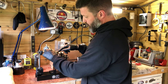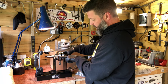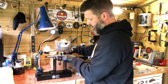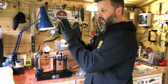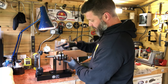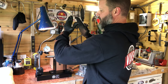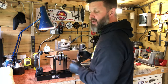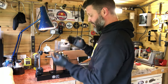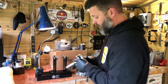That's where you use the hammer. You'll read the dial gauge: if it's going up and down at the 90-degree mark, the webs are oscillating slightly. If it's moving up and down at the top or bottom, the webs are pinched out or pinched in. If it's doing both, then both problems are happening and you've got a bit more work to do.